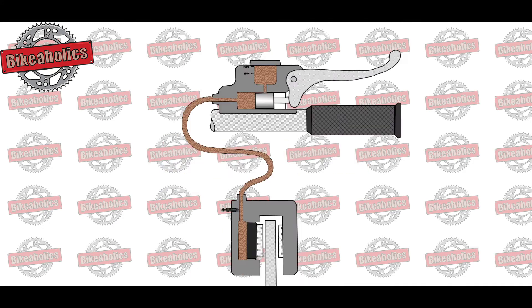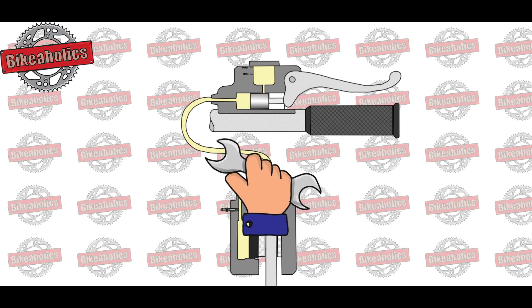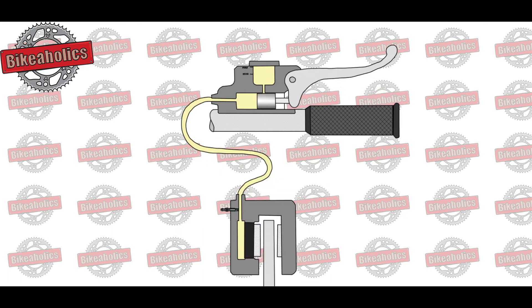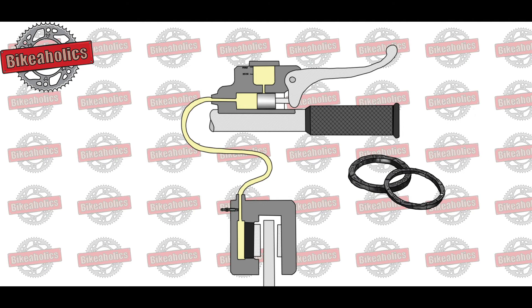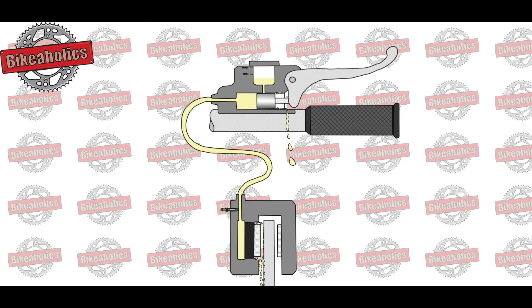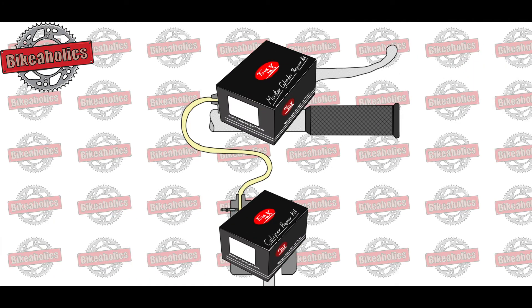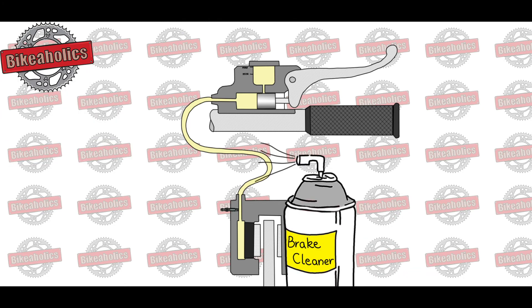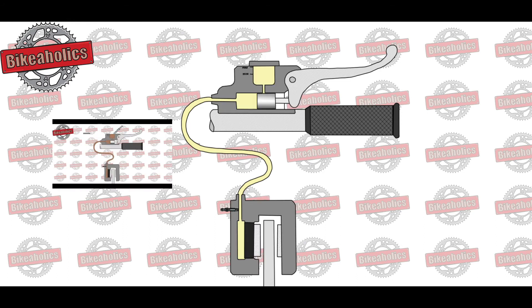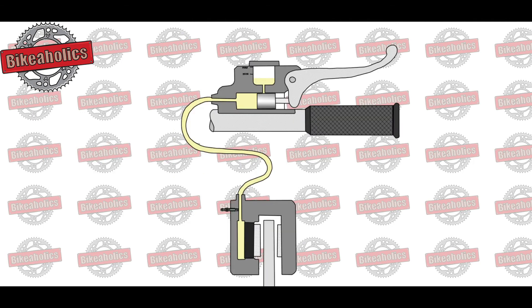When do you need a repair kit? Old brake fluid is not able to protect the brake pistons and cylinders from rust and lubricate properly, which can lead to master cylinder or caliper repair. Even though the brake fluid has been taken care of regularly, the elements will cause the rubber seals in the piston and caliper to disintegrate, and over time this will cause brake fluid to leak. Luckily, there is a wide range of master cylinder and caliper repair kits on the market, so you can rebuild them. Follow the service manual and clean everything with brake cleaner and soft paper towel. Once the kit is in place, refill with fresh, good quality brake fluid and accurately bleed the system. Pro tip: carry out regular checks for the brake fluid level. If the level drops, refill the tank. However, if there is a significant and regular loss, check where the leaking is.